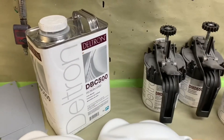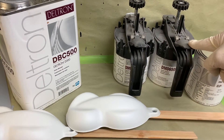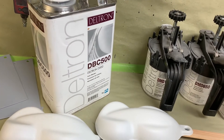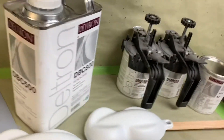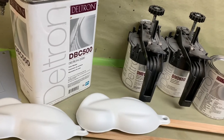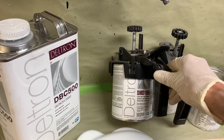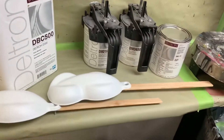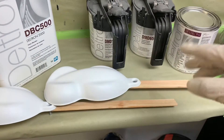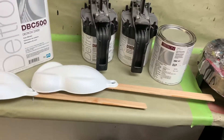The actual formula is gonna call for DMD 650. It's a pretty coarse metallic, but we're gonna do spray outs using the 650 and the 1696, which is a little coarser metallic — it's a different type of metallic. The 1696 is a lenticular metallic, they call it. Basically, instead of being like a star, it's like a star on top of a star. It's got much more peaks and points to the metallic than just a star-shaped flake.